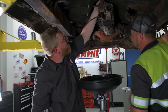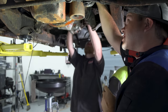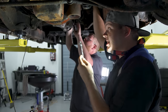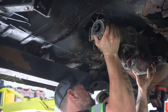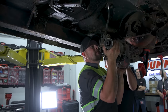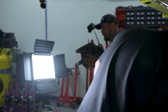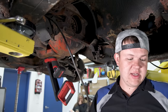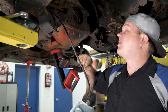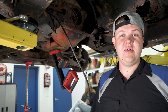It's a smell you can't get rid of for a long time, especially if it gets in the carpets. This has a rear engine mount - it doesn't have a transmission cross member, so we don't have to take the transmission cross member out and try to support the engine. The engine's sitting on four mounts right now. I see a rusted over clutch and a seized throwout bearing. The Saginaw transmission is sitting on the tires.